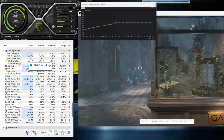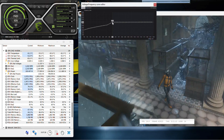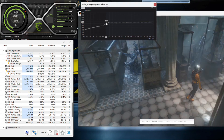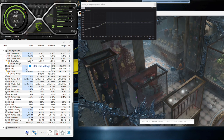Making sure they are on the same frequency, we save the profile. We need to do that along with a running benchmark and continue going 25 millivolts down each time. On this GPU, we achieved going down to 875 millivolts while staying very close to our stock boost clock. You may notice that although you set the value lower, the Vcore tends to increase by a bit, so there is no point in going further down.